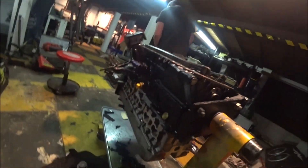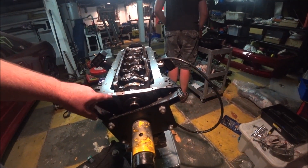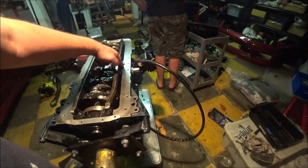It's almost midnight and lots of stuff is done. Just fitted the rear main seal. I can't really torque it up properly there, but I've done it up with spanners and I'll check the torque tomorrow when I get it off the stand. It's only 6Nm so it's bugger all anyway. About to fit the sump - but before I fit the sump I've got to fit the pickup. It's about the third time I thought I'm going to fit the sump and then realize I've got to fit the pickup. I'll slam the pickup on then put the sump on.